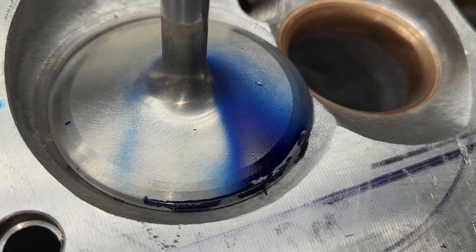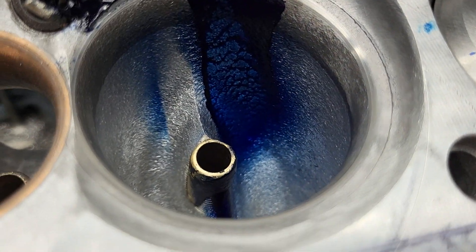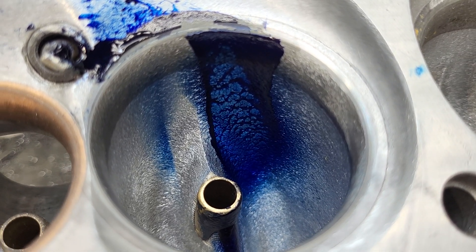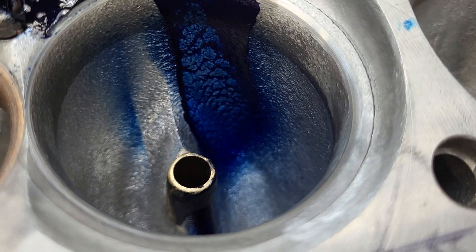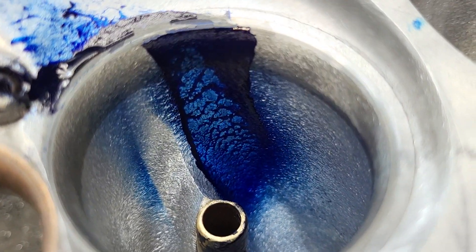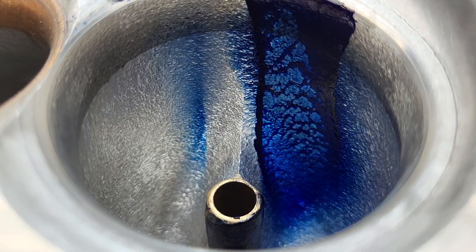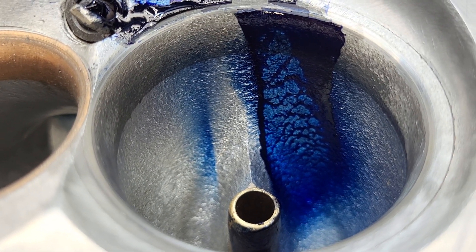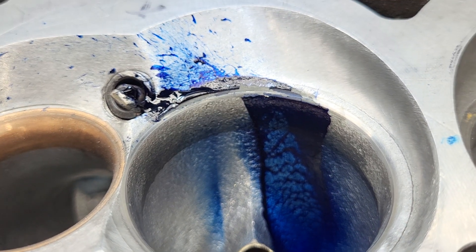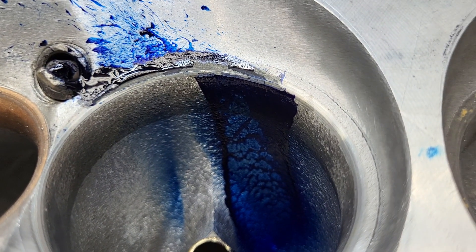As far as our valve, we got a nice spread on our valve, and we got some on the center of the cylinder. We are nice and wide in the bowl — we go right to the floor. I did have to change the angle of the fin radically. It's much shorter than it was, and it is angled in such a way as to move that liquid flow over.